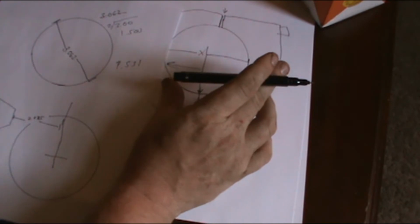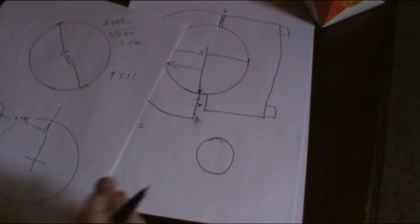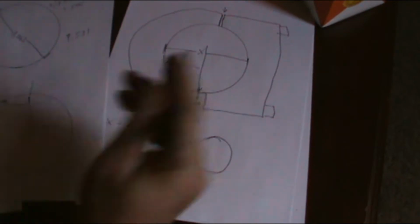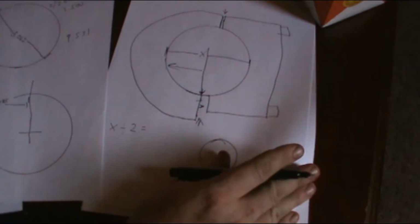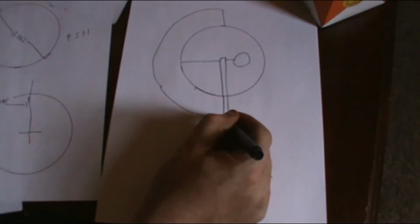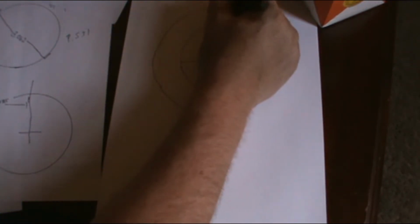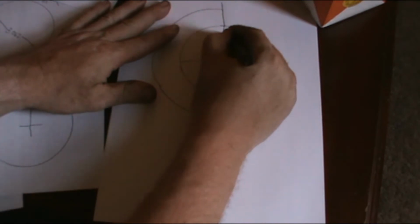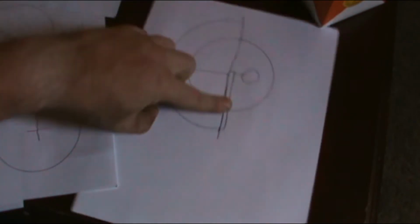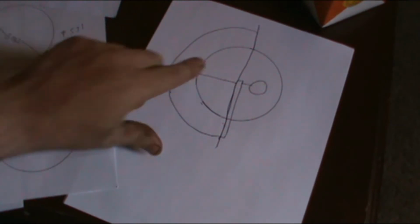I do have a bit of machinist background, but just in case. But anyway, in my case, I got the same number both times, so I have 1.531, so I know that my bearing center line worked right off the edge of this thing. This is this plane for me, this plane right here. I can't believe I just traced that line. This plane was exactly the bearing center line. Okay. Remember, this is the bar, this is the tool.